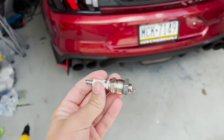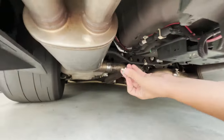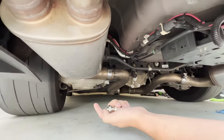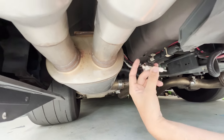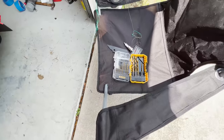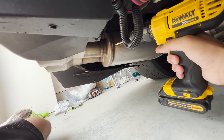So the first step is to put the spark plug in — we're essentially going to weld it onto my dual exhaust system. Step one is getting the spark plug positioned; we're going to be drilling a hole in the muffler. I'm not going to be going down because it would hit the floor — I am going to be installing it right here on the side. Hopefully that should be enough to get some flames coming out of both exhausts. So step one, we're going to be marking a hole about right here, and I'm going to be drilling right into it. I'm just going to be using a quick little DeWalt drill — I'm going to start small and then work my way up to the half-inch one. It told me to drill a 9/16 hole, but we're just going to go up one size at a time until the spark plug fits.